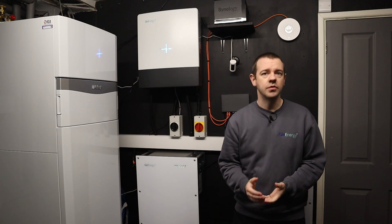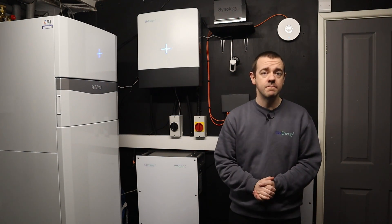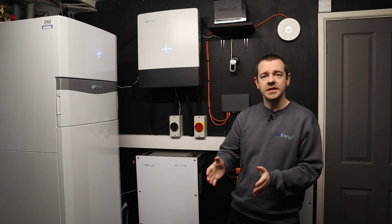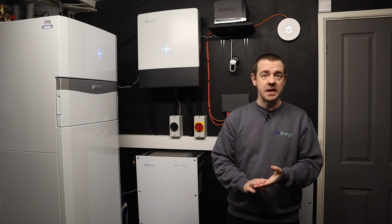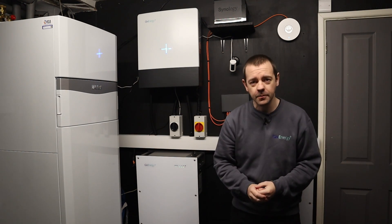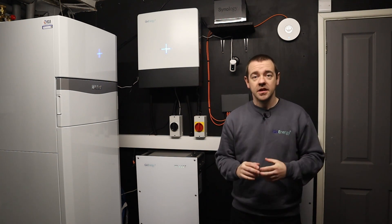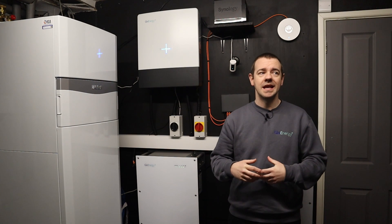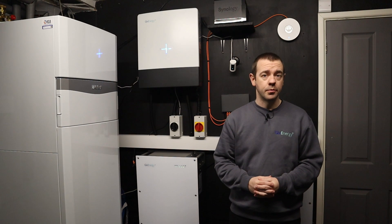Another thing worth timing right is your internet usage. You don't have to do this, but if your internet has been maxed out — if someone is using an awful lot of bandwidth — it can affect the firmware update process. So it's probably worth waiting until nobody's watching an ultra HD stream, doing a big upload to YouTube, or anything that's using your entire internet bandwidth, upload or download. You don't have to kick everyone off, but it is worth waiting until nobody has heavy bandwidth requirements.